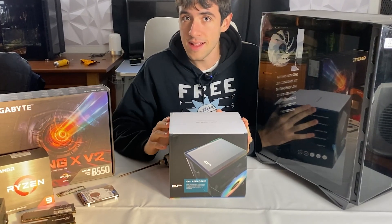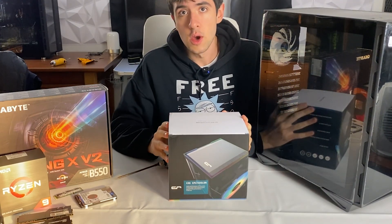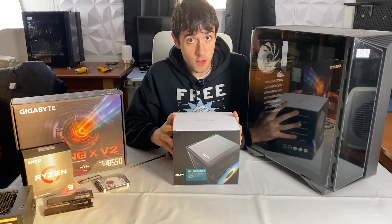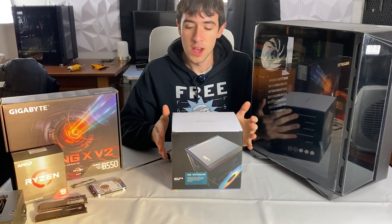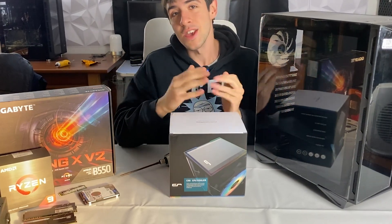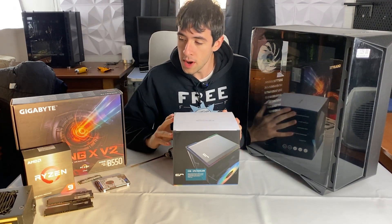Generally when going with air cooling you want a very high airflow case, which is something that doesn't really matter if you're going with water cooling. Towards the end of this video we will discuss more about when you should get one or the other. As of right now, let's focus on this cooler. It has a full copper base and is supposed to handle up to 260 watts of TDP. On this Ryzen we want to see if it can handle full power without losing performance — obviously if you undervolt it you can cool it with basically any cooler, but that's not what we're after.